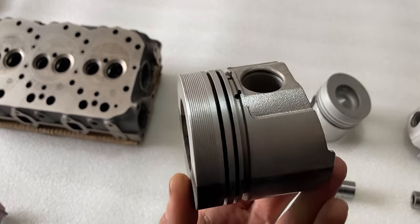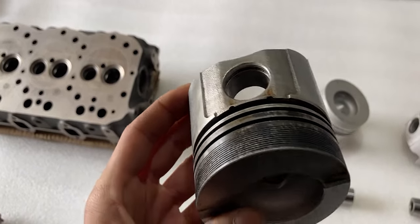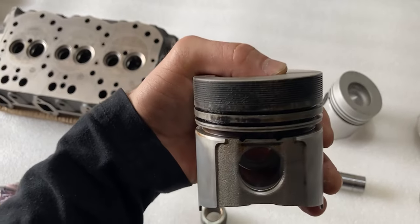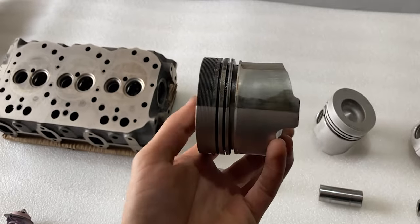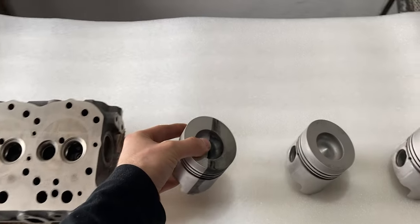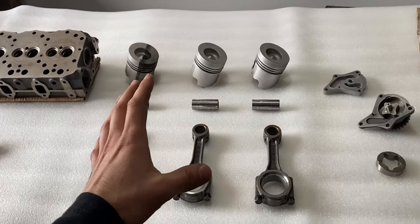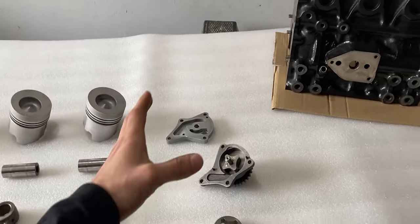On the right side you can see the piston is perfectly clean, but on the left side you can see the original condition of the piston — a lot of carbon buildup above the top ring and within the grooves for the piston rings. Along the wall of the piston there's also a little bit of discoloration. I'll talk about the sizes and what I noticed a bit later.